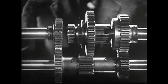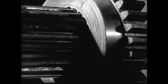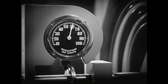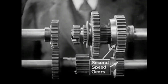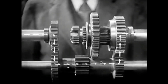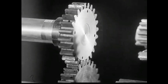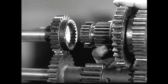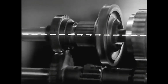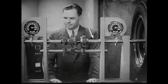After we've started the car rolling we want fast pickup, so we shift into second by sliding the sleeve backward to mesh with a gear on the shaft to the rear wheels. The wheel is now turning at 60 revolutions a minute. For higher speeds we let the power go directly to the rear wheels — we shift the sleeve forward so that it meshes with the shaft from the engine. The power travels straight from the engine to the drive shaft, and now the shaft to the wheels is turning at 90 revolutions a minute, the same speed as the engine.